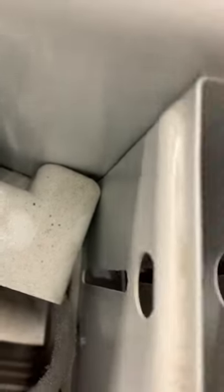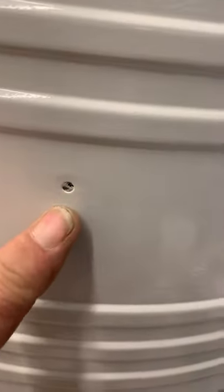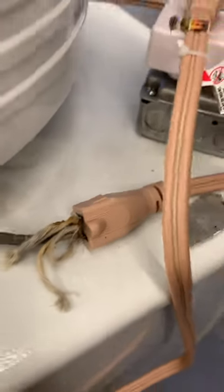The relay — I'm pretty certain it goes down in here, and there should be enough wire left to pull it out and rewire this thing. I know I'm going to have to take this top apart to get to the terminals of the compressor underneath. I'm pretty certain this screw hole right here is supposed to hold that relay in place — it's just kind of dangling in there. I wanted to see if it ran before I even bought it, and that's how I'm running it right now, but I'm not leaving it like this. I'm just running it while I'm here and watching the amperage.